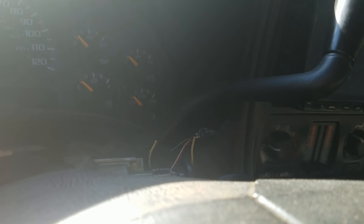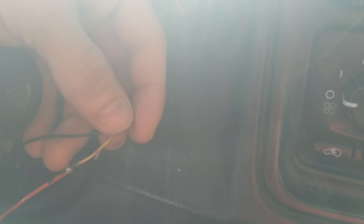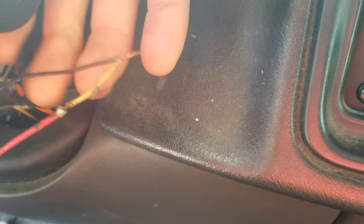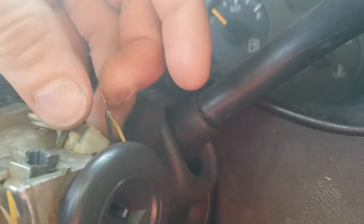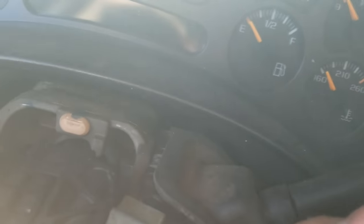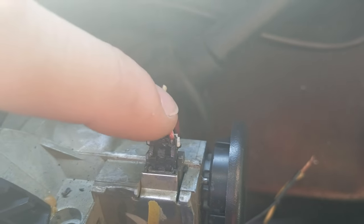I got the yellow and black wire connected — I just stripped them with a wire stripper and twisted them together. Make sure they are connected very well. I had to replace this yellow wire, that's why it turns to red here. Normally these wires come up to the connector here, so just unplug it and connect your yellow and black wires. Sometimes your wires might not be the exact same color code, so just use the middle one and the one on the left and connect those two.